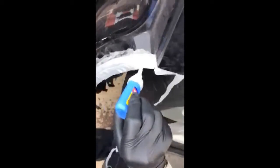That's creating a little crease here to tighten this up. So I'll just have a little pocket left, but I want this face to be flush and this face to be flush. There's too much distance, so I'm just creating a little crease, hoping that will just harden like that, and boom, created the crease. So now all the faces are okay and there's no high points. And now, when we go with our filler, we can just fill in the little crease I made.